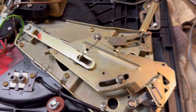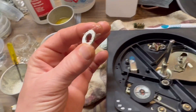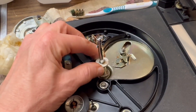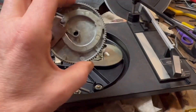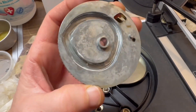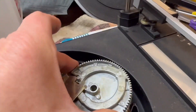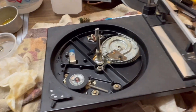And now I'll clean and put it back together. This will work nice and smoothly now. It's always kind of a messy job, but you get the bearings all cleaned and repacked. That will ensure a nice even platter movement. And now it's time to put the cycling cam back on. The channel's all been cleaned, and a little light lithium grease in there. Get that set and adjusted.